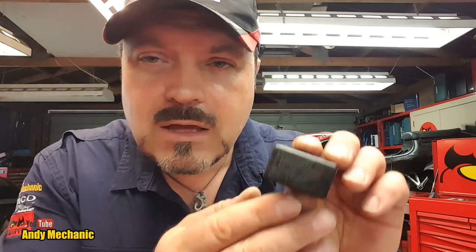And I had a sneaky suspicion that was the flasher relay, but it was quite complicated. I'll go and get it and show you what I mean. So this is the relay I thought was a flasher relay on the bike, and that's the part number there. Look, it's a Denso relay made in Japan, and the part number is 066500-4230. A bit hard to see on there, I think. Oh, you might just get it now.